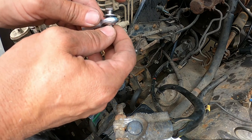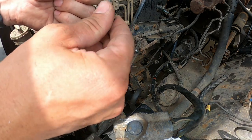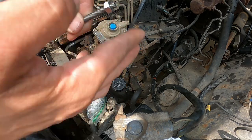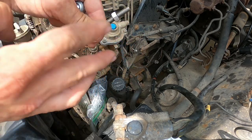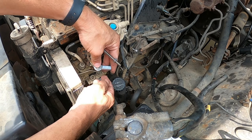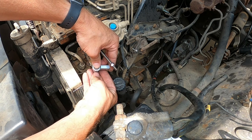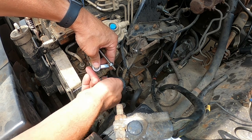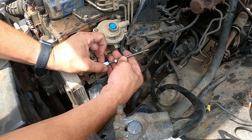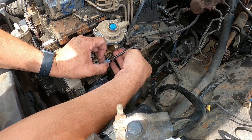You put your washer on your bolt, then put the bolt to the heim joint. On your all-thread, take two of the nuts and thread them on — this is what's going to lock down your heim joints and keep your settings. Put the first end through the hole already in the throttle arm, put your lock washer on it, then put your nut on the bottom. Thread this into the front heim joint and see how far back we need it.